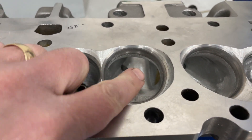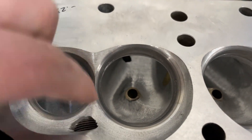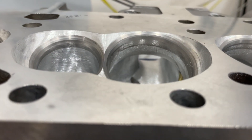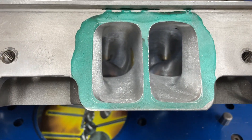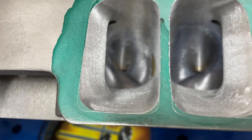I always like to put those brass tubes in because I've seen them actually gain horsepower. So for the port shape: I used the 2.10 valve, ported to make the bowl bigger, made the throat bigger, and reworked the short side. I also opened up the pushrod pinch.